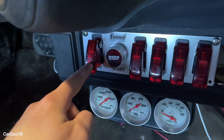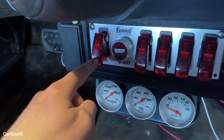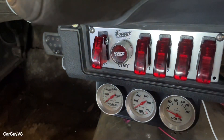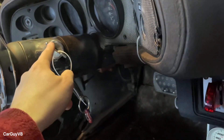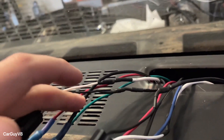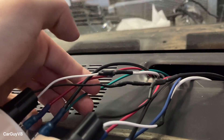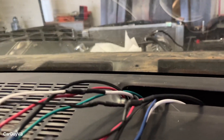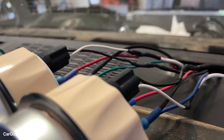If you didn't have an ignition switch you would have to either use a fuse extension in the fuse box or wire it directly into your ignition. Then we've got our ground which goes to the same spot. And then this green wire is our special wire going to the S terminal — it goes through the firewall and under the car back through a wiring passage where all of my rear wiring goes.